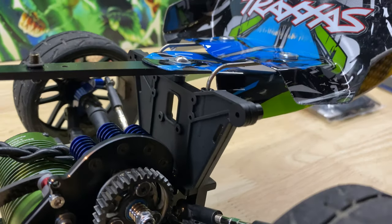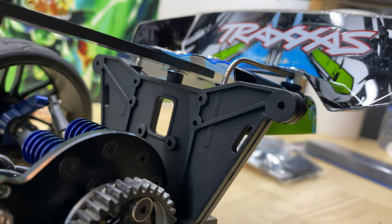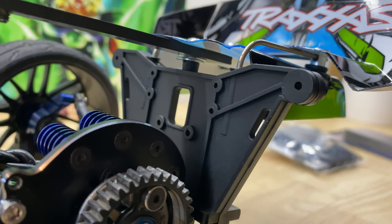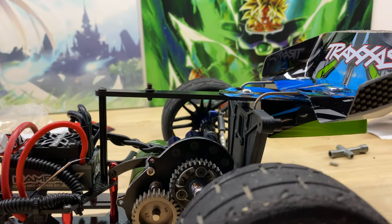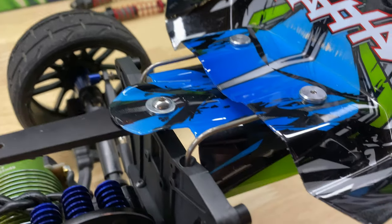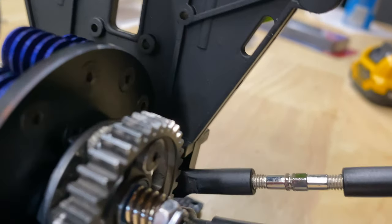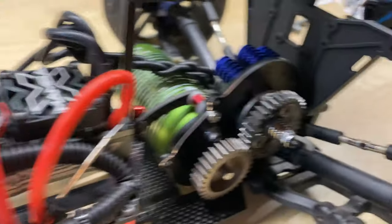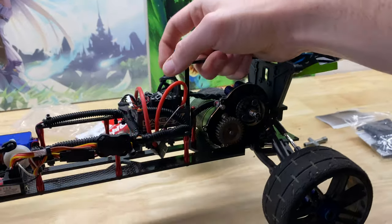New shock tower is on. I only cut it right where that pin would have normally been, and I have two small washers on the bottom to level out that brace, then one washer up top. I had to cut that bolt down so it wouldn't go all the way through the hole. Looking good — still just as strong as before; you can lift the whole truck up.